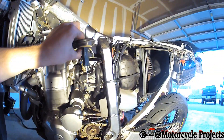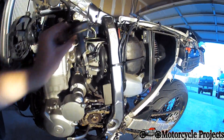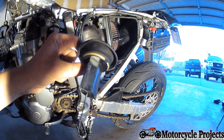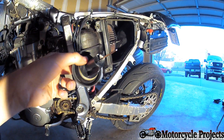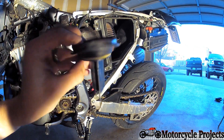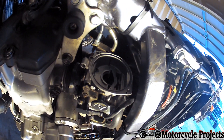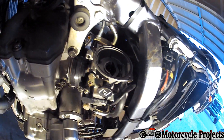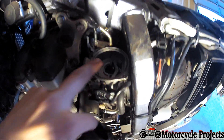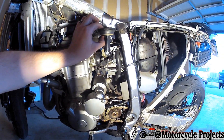The diaphragm sits in the top of the carb and only goes in one way. The diaphragm is this rubber boot on top, and it holds the needle primarily. There are a couple of air vent holes here and another air vent hole here. Those are designed to control the airflow into and out of the diaphragm area, which is actually the air pocket beneath the metal but beneath the rubber. And what this does is it acts like a balloon.